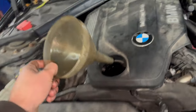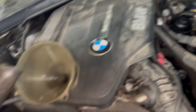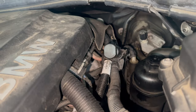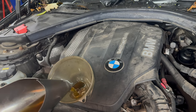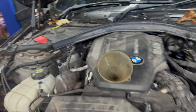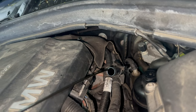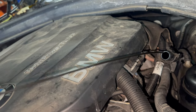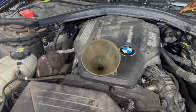Showing five litres. As far as I know there's no dipstick fitted as standard — I'm not sure if that's a cap, but there is an oil level reading on the iDrive. So add about four and a half litres of oil — quite often these are just capped and the dealers will have a tool or their own dipstick. I'm going to add about four and a half litres of oil now.